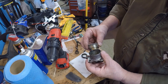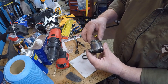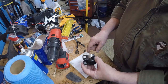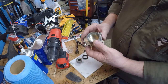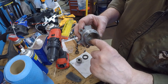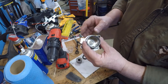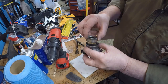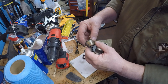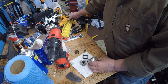This slave cylinder - I got it out, then I took the rubber seal off that goes around it and put it in. It stuck and I had to get the air compressor again, hold my thumb over it, put air in at the bleeder hole and pop it out. It's binding up. You can see down in there - that should be all just smooth metal, but it has a ridge from the rubber seal that's been sitting so long. When I put the piston in, it should fall right in. You'd never want to take emery paper or sandpaper to this.